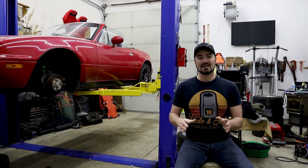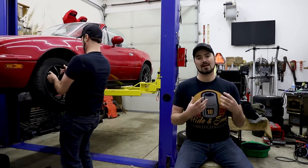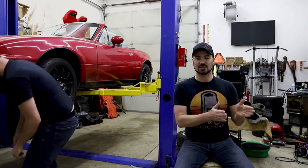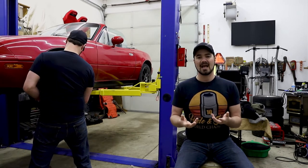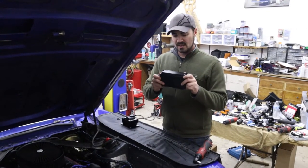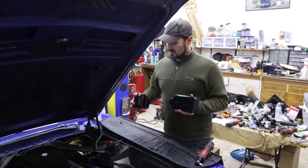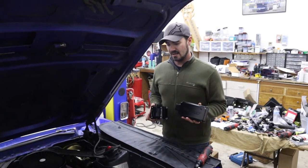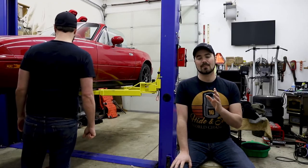So we sent that back. The company was great — they RMA'd it and sent me another one that was correct. I got the distributor in and then had problems with the other Holley parts. The other two parts to the system, the ignition box and the coil, are somewhat universal parts that Holley offers. I'm sure the ignition box is probably a rebranded MSD because it seemed pretty standard. But when I had everything wired up, I couldn't get the coil to spark. After a few tries with Holley's tech support on the phone, testing all the wiring, they concluded it was probably a problem with the coil.